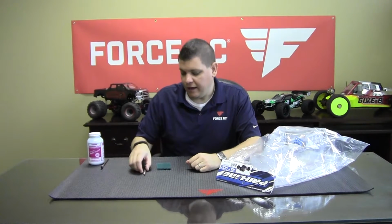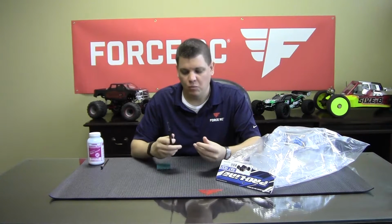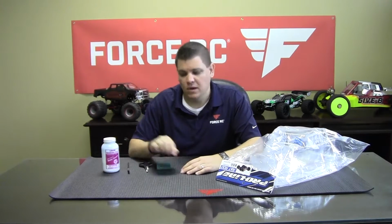All of the items that I use, I'll put a link in the description so that way you know where to get it. So we're going to use a Lexan scissors. It's a curved scissors which helps get around wheel wells and works best for really all different angles of the body. And then we're going to use some liquid masking on this one. It's all a matter of personal preference. I like the Bob Dively model aircraft liquid masking. It's always worked very well for me. And then just a cheap paintbrush from your local hobby store.